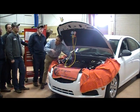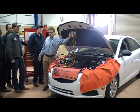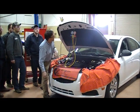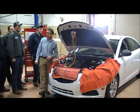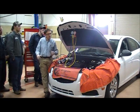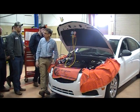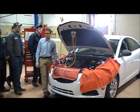Once I've turned that connection on, there should be pressure up to the gauges. This vehicle has been off for a little while, so this is static pressure I'm reading. I've got about 60 PSI on the low side and approximately 60 PSI on the high side. That static pressure just tells me there's some refrigerant in the system — it doesn't tell me if the system is charged too high, too low, or if it's just dry. It just tells me there's some pressurized substance in the AC system.